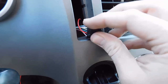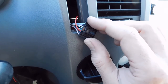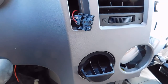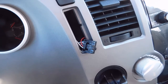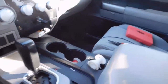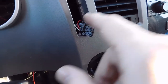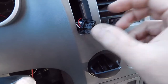In the pin numbers they wire into: I wired the red one into pin 3. Pin 3 goes to 19 and pin 2 goes to pin 17 down there — so it's kind of in numerical order: 2 goes to 17, 3 goes to 19. I've got both wires in there going to the connector where they need to. I'll show you underneath here — just routed them under here, they're loose for now because I want to make sure it's going to work first. When I plug that connector on, I'm going to hold onto these back two wires to make sure they're not pushed out as it's going on.